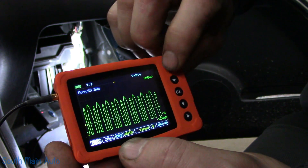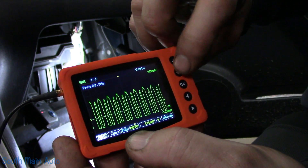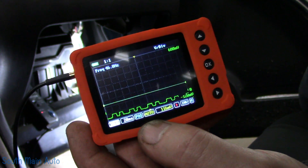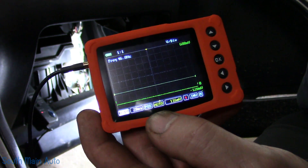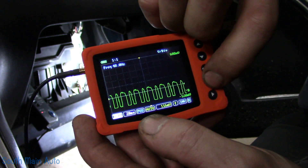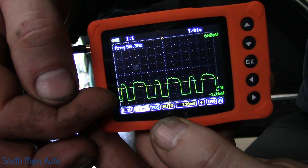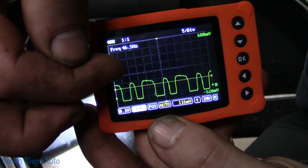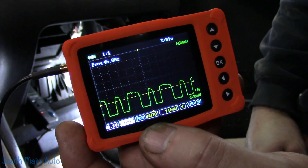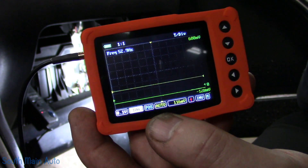Let's draw some more amperage with this thing. There we go, that's a little better. That, folks, is bad — it clearly has an open segment in the motor. Why on earth does this thing start every time I turn it on? I have no idea. Because if it falls on any of those open spots — the spots in the graph here — every time the amperage draw is back at zero, all the way down at the bottom, that is an open spot in the motor. What we should see is a nice, steady current draw; of course, we're going to see little ripples each time the brushes come across the commutator. However, this motor should not be running — it should not start unless it stops on a good spot every time.